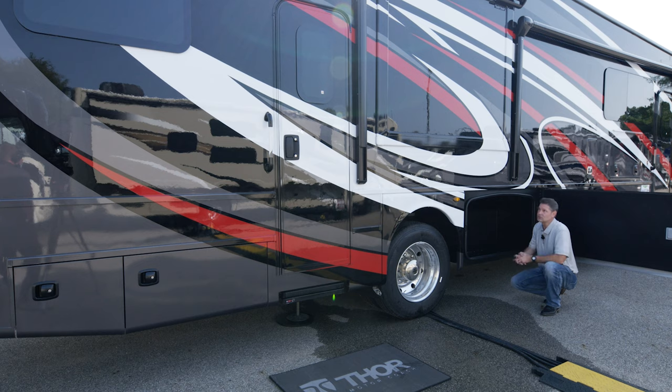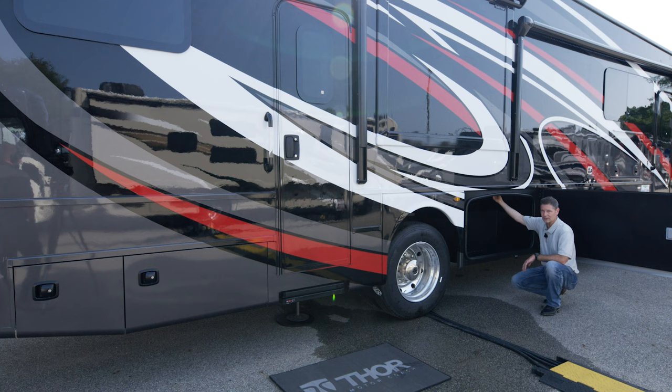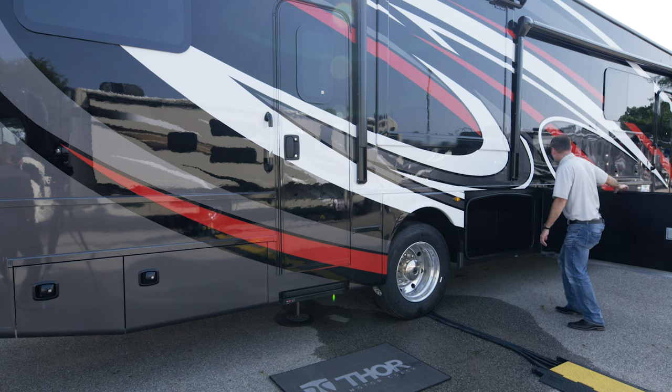In the event you need to manually put the slide wall in, you can go ahead and unplug the plugs here — it will tell you exactly how to do it right there, and there is also a video explaining this. Unplugging releases the motor, and then you and your friends can go ahead and put in the slide room. On this one it's a little bit smaller, so you can probably get it in with two people. Then put those plugs right back in. We'll talk about troubleshooting and re-syncing your motors when we get to that.